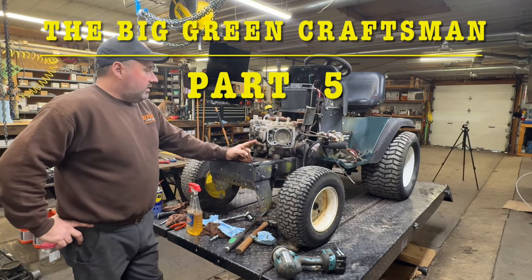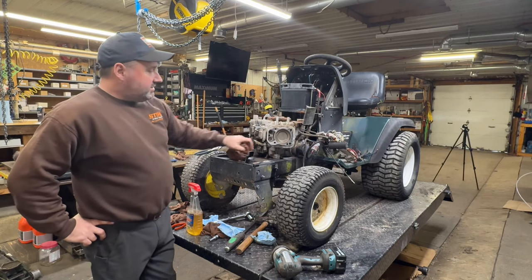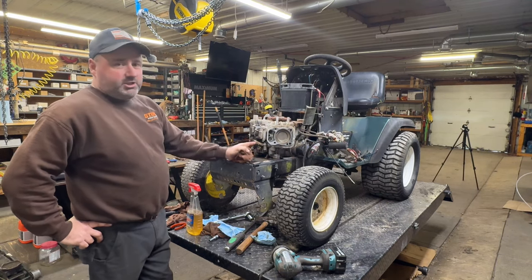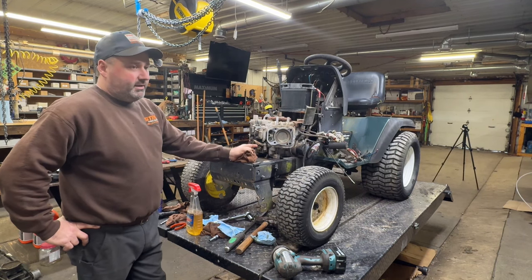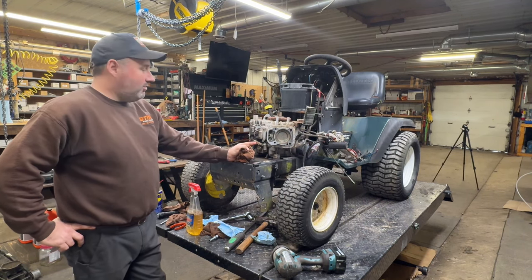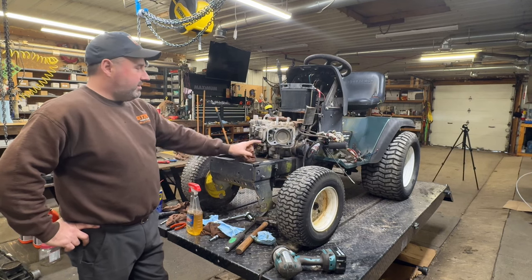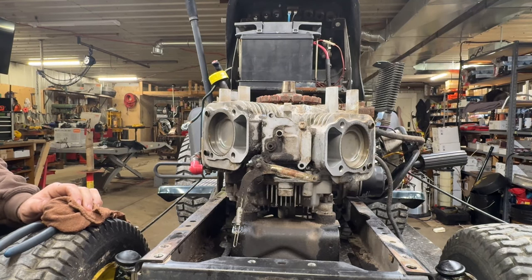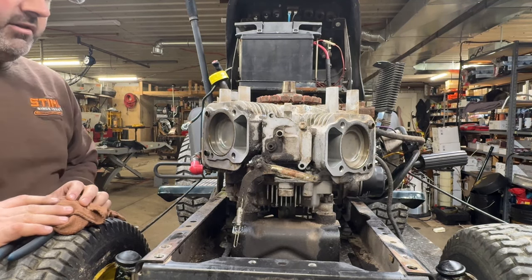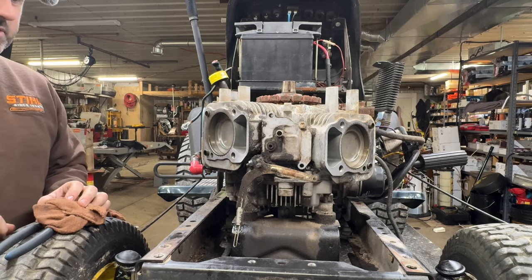So I got the gasket surfaces all cleaned up, carbon cleaned off the pistons. I think I'm going to change the lifters too. I don't know if they were noisy, but they're a part known to get noisy, ticking. And I have a new set here, so they're not much money. I'll throw them in. Besides that, I prepped the flywheel for magnets and got them all glued together, and I was working on one cylinder head. So follow me, I'll show you what's been going on.